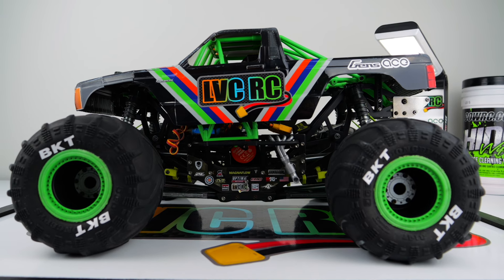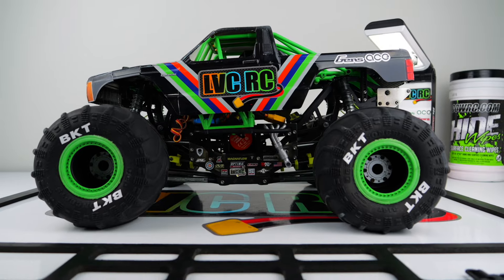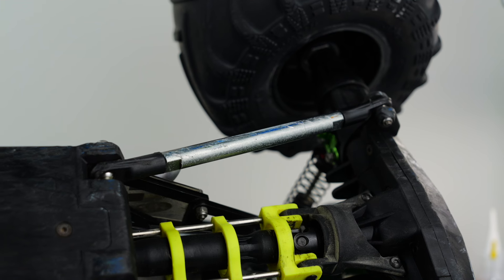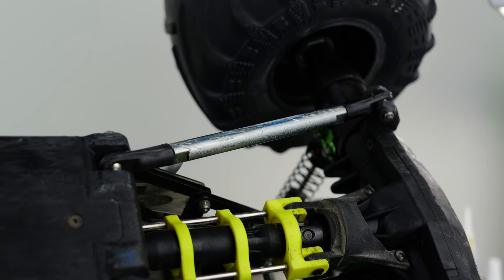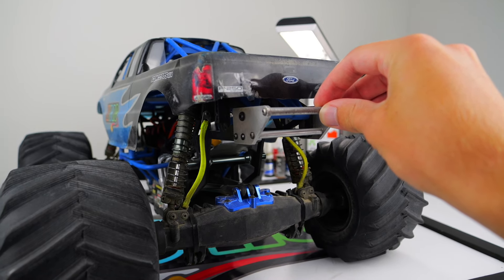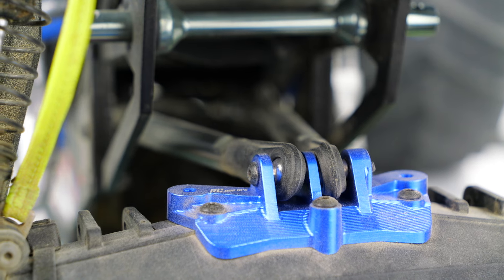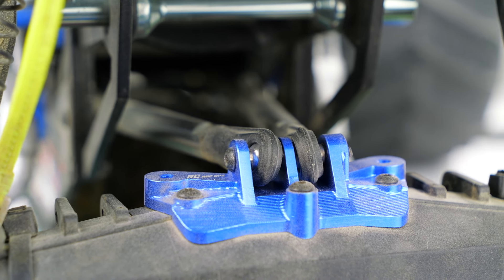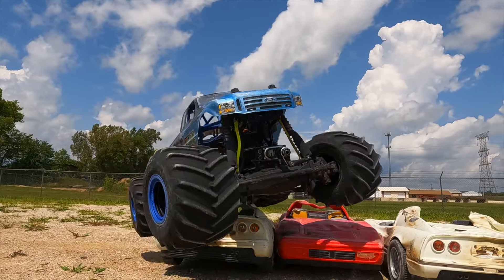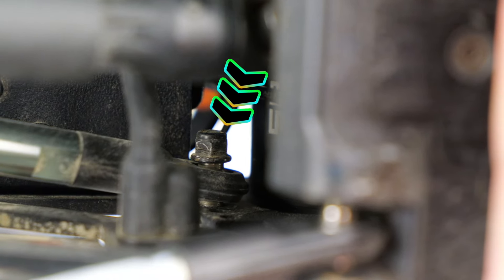The rest of the suspension on this truck is pretty durable. The rod ends on the lower suspension links are typically the first to give out, but they're quick and easy to replace, so it's a good weak link to have. The rod ends on the links commonly wear out, which causes the truck to develop some side-to-side movement. Once it gets bad enough, you'll want to fix it by replacing the rod ends. The flange nuts on the upper suspension links also tend to come loose, so keep a closer eye on those as well.